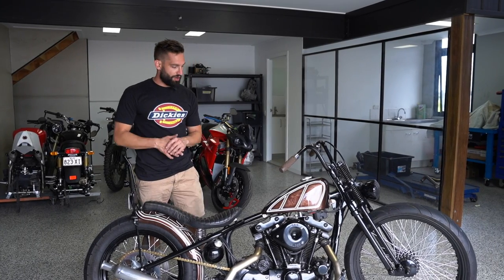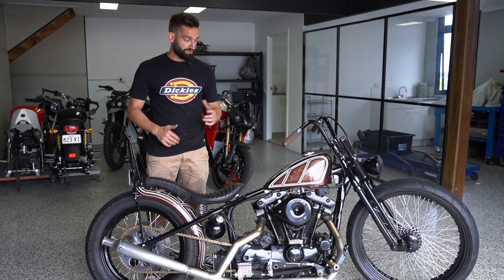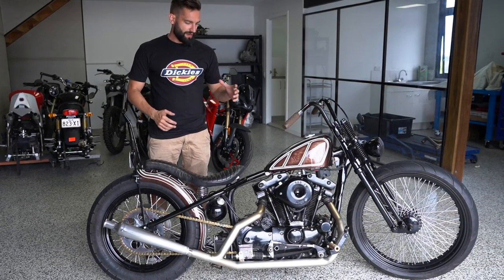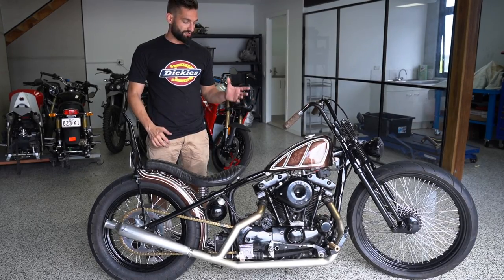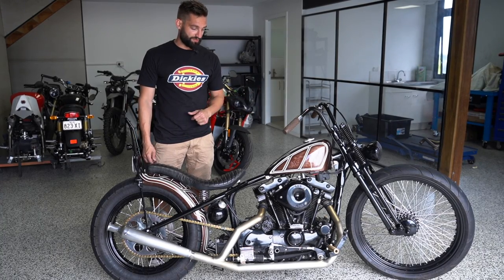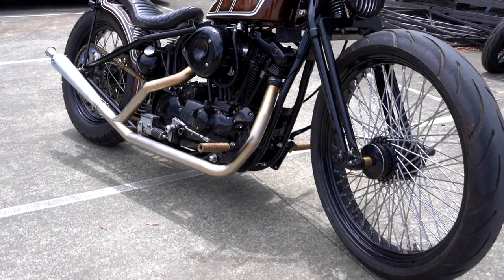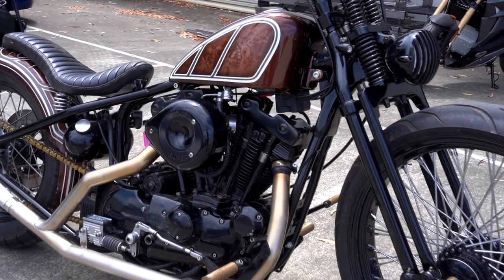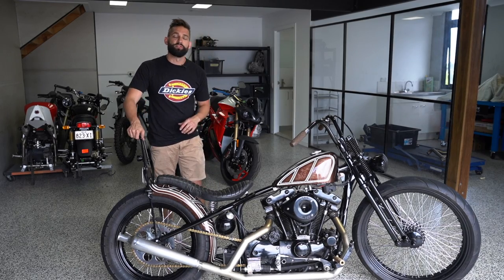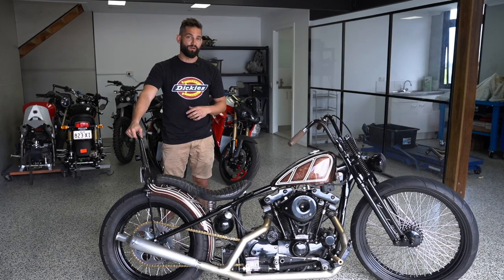Once we'd finished all of our wiring work and everything else, we had to tweak the carb a little bit because it was running a little rich, but the engine fired up really quickly. It actually starts so nice and it runs super quiet too. The owner was told when he purchased it that the engine had been recently rebuilt, and if the sound of this thing is anything to go by, he's done a pretty good job — there's no noise in the top or bottom end. All you can hear is those two pots pumping out the exhaust. I'll start this thing up for you in a second so you can hear it running, and I've got to get out on a test ride before Trent comes and picks it up. Thanks for watching another episode of the Purpose Built Moto Quick Fix — make sure you hit us with a comment below, like and subscribe to the channel, and we'll see you soon on the next one.